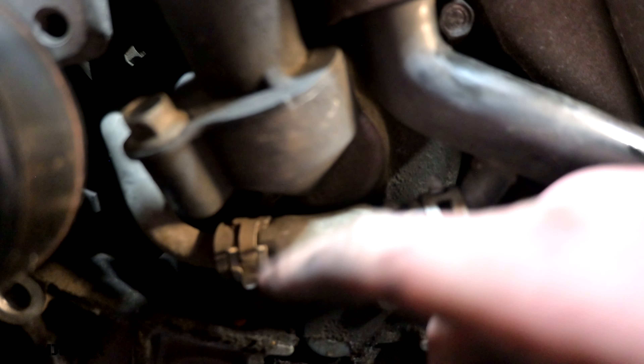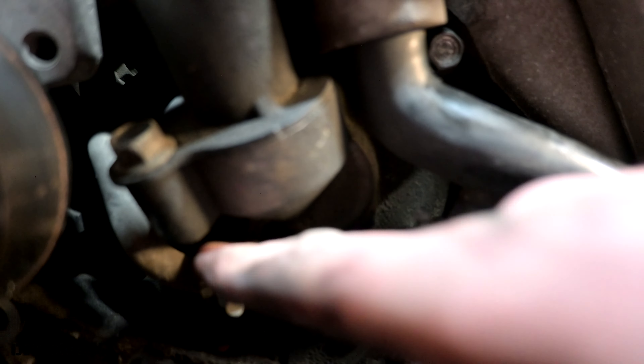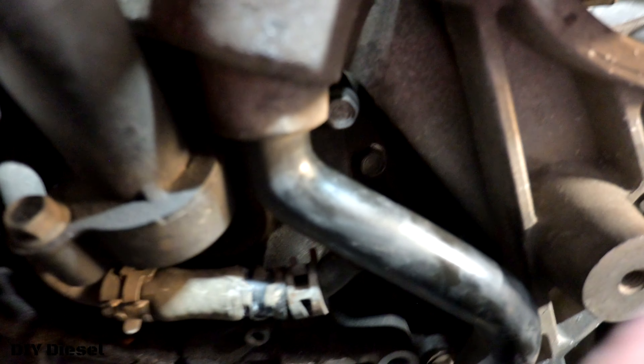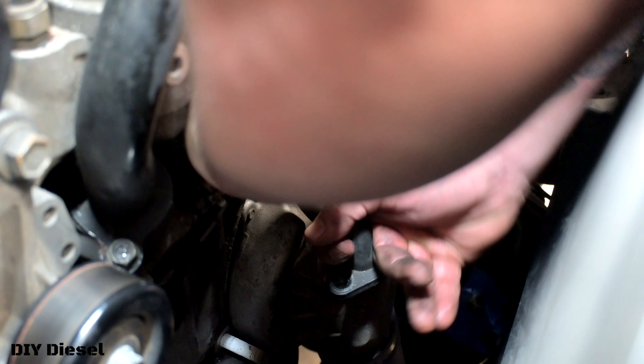You've got to disconnect this hose from the upper cooling pipe that goes onto the top of the water pump, which comes out from the bottom of your thermostats. You're going to remove that so you can turn or pull out that solid hose. We're going to opt to pull it out instead of just turning it — it's just going to make life easier.